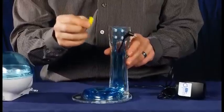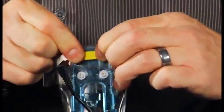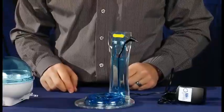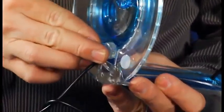Reinsert the locking bar into the top two snap fixtures and push in. This prevents the drip tray and table stand from accidentally separating while the dispenser is mounted. Reinsert the key into the bottom of the drip tray and snap into place.